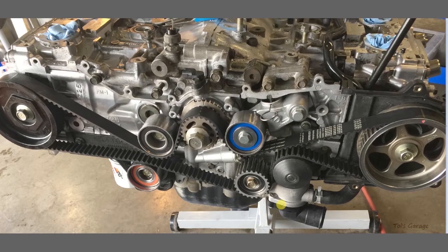The engine we're looking at on the screen is out of a 2005 Subaru Impreza. In the center is a crankshaft sprocket. Note the timing mark in the front as well as on the back side of the sprocket. These are in the 12 o'clock position and aligned with a timing mark on the engine block right here. EJ25 cam timing is not set at top dead center. With these marks aligned as shown, the pistons are all at mid-stroke. This provides clearance between the valves and piston tops so that you can rotate the cams into the correct timing position without having the valves strike the piston tops.